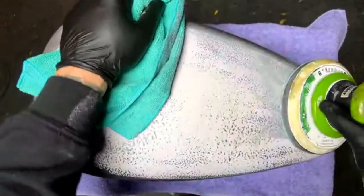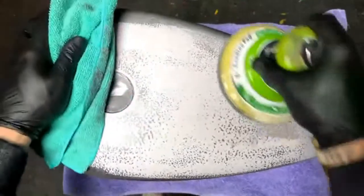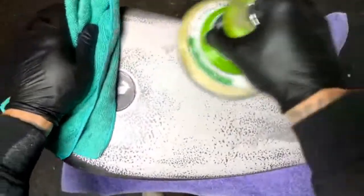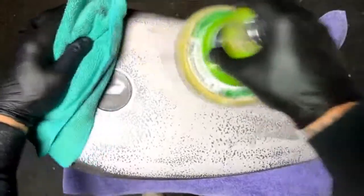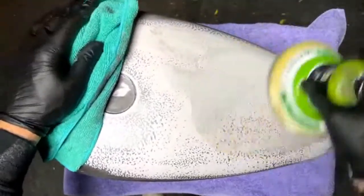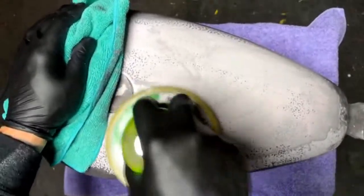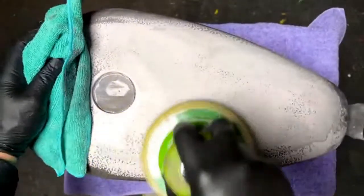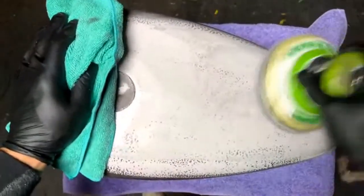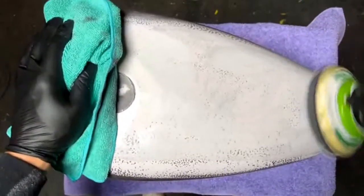But what was the question? I think I'm talking. I can't remember. After you tape out your panels and mask them for spraying. Oh, yeah. It's always nice, because you got a nice, smooth, sanded clear coat that your paint sticks better. I always like to re-clear stuff and then come in the morning, sand it, and do more, and then just clear it again.